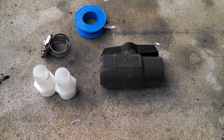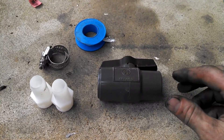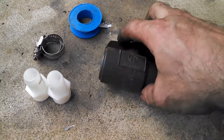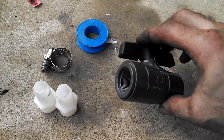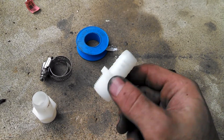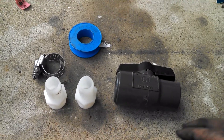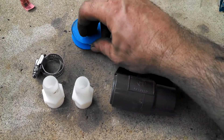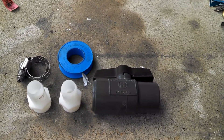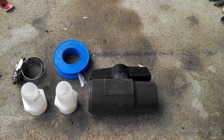Welcome to Southern Maryland Performance Web Episodes. What you're looking at here is a three-quarter Hayward ball valve. It's a full flow port valve, meaning there are no restrictions. Using some three-quarter schedule 80 or schedule 40 pipe, two hose clamps, and some teflon tape. We're working on an '06 Sea-Doo RXP-T supercharged with an intercooler.